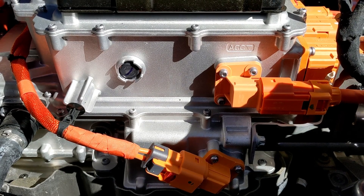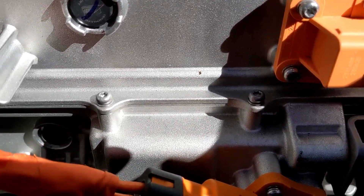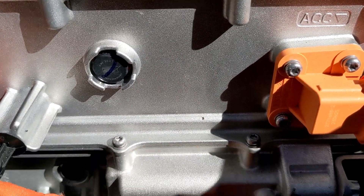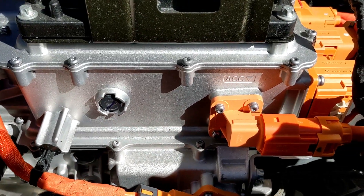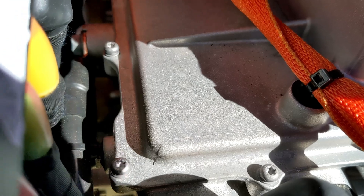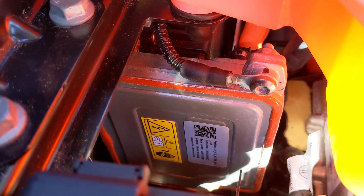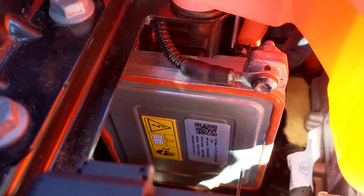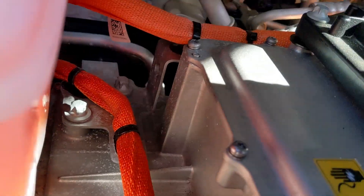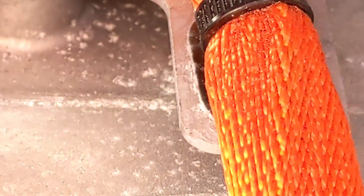This is looking at the existing corrosion patterns in the engine compartment. Here's the central engine compartment — you can see this looks basically brand new. I kind of doubt that significant water is coming through the fan or under the hood. Unfortunately, I cleaned all this up before filming. This is the right side near that opening that allows water in by your heater. There was substantially more corrosion on the right side — that's what the whole right side used to look like. I think most of the water is coming in on the right side through multiple locations rather than directly from the front.